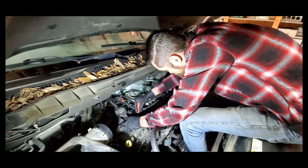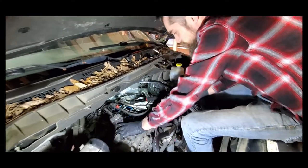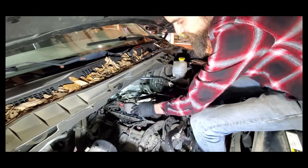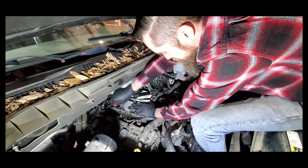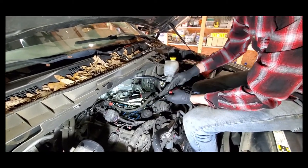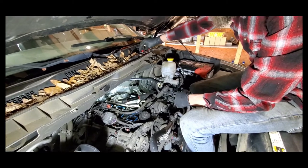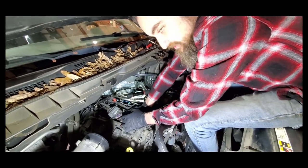You can still smell a little bit of gasoline. When I opened it up you could smell it — it would have been substantially worse if we'd disconnected the fuel rail. Right now there's probably about 45 to 50 pounds of pressure per square inch sitting in that fuel system. That fuel is just waiting to spray out — and when it does, it gets everywhere and it stinks.